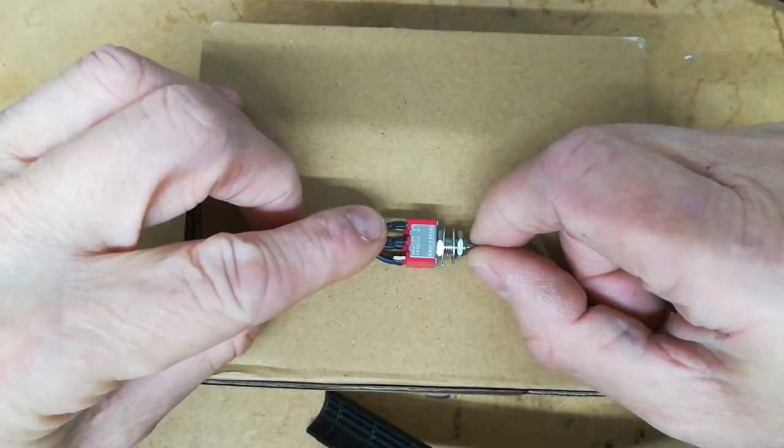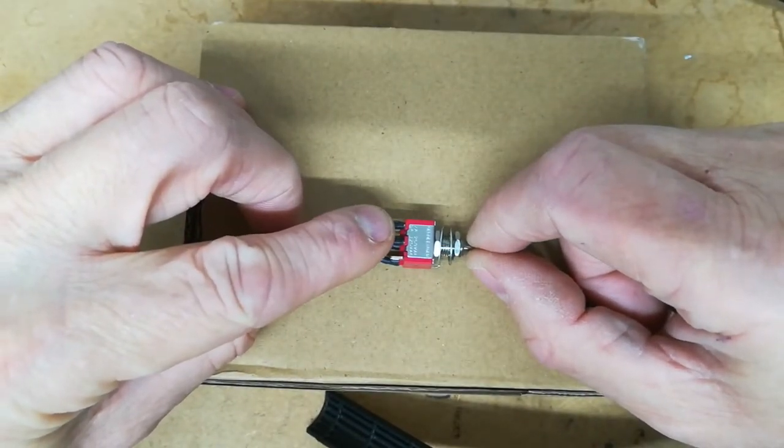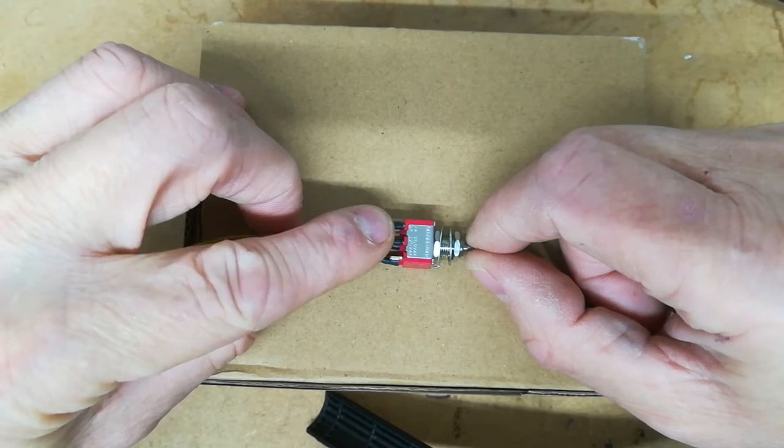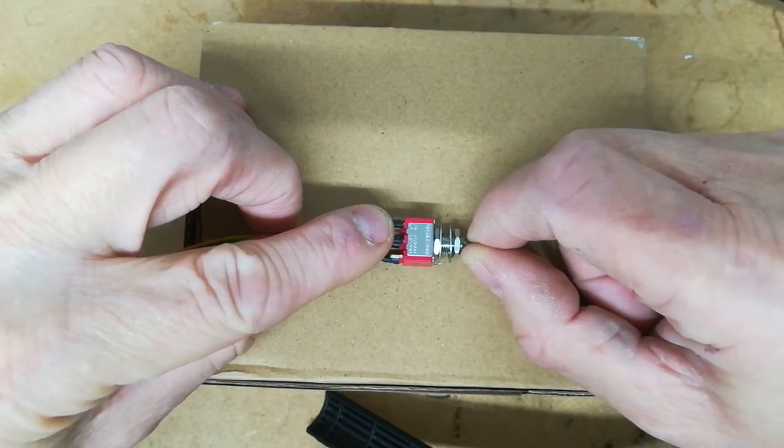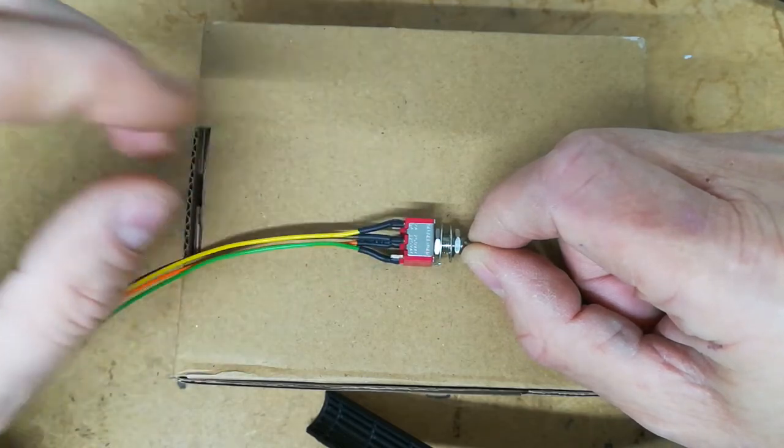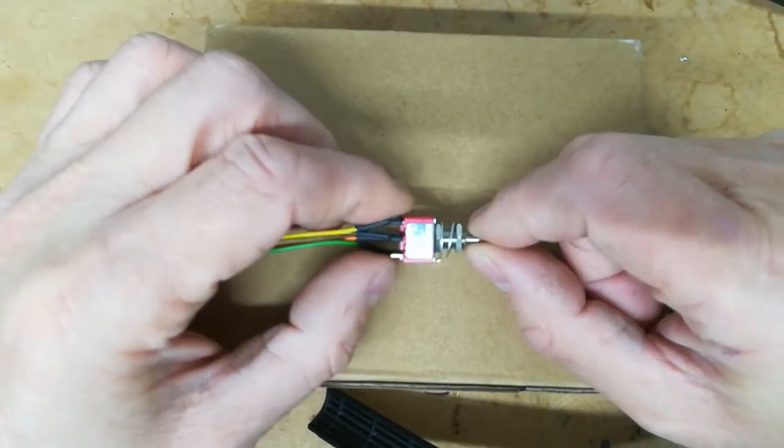You'll have noticed on your CRZ, if you touch the brake lightly when the car is regenerating, then you get an increase in the regen level. That's useful to have, but it would be nice to have that without actually having to press the physical brakes and activate the brake discs, etc. So you get a bit more extra energy. That is the non-locking part of this switch.